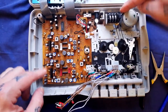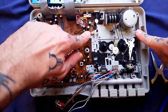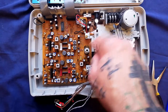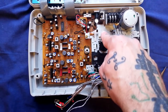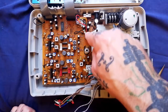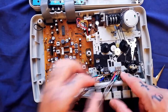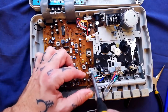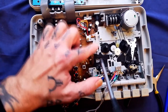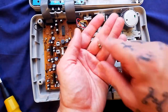There are five screws holding the transport in. Some of them have common ground connectors, basically making sure that all the points labeled earth on the diagram join up to the same place so you don't get a buzz in the system. There's one up here connecting into the lower printed circuit board, and one wired back to the play and record head. When you reassemble, just make sure those two ground connectors go between the mounting screw and the chassis plate on the transport. Unless I say otherwise, all screws removed from this point forward are about a centimeter and a half long, brass in color.